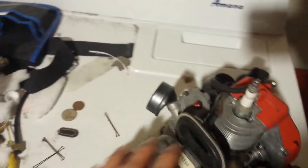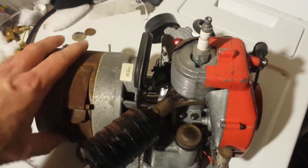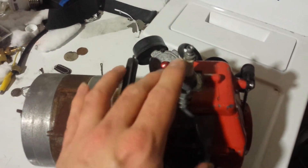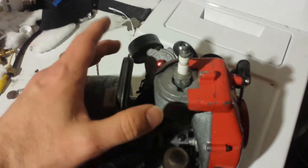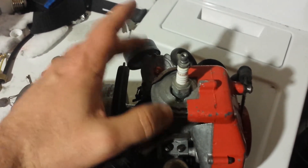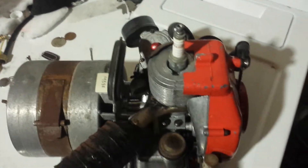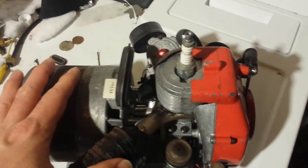So I'm actually going to test that little beauty here. Right now it doesn't work. The compression is good, spark plug is good, magneto is good as well, but apparently according to the eBay seller the carburetor is jammed a little bit with goo and the gas tank needs a little bit of clean up.